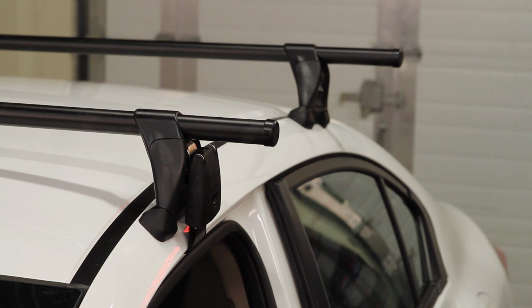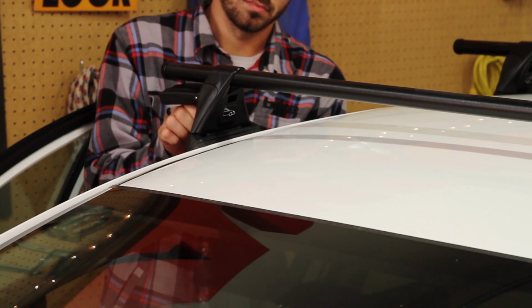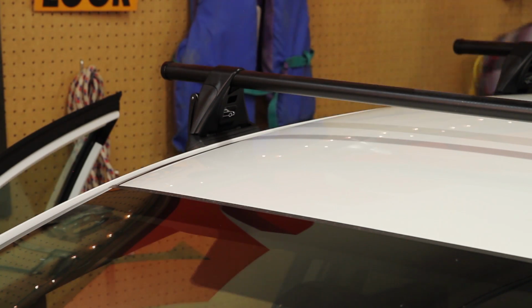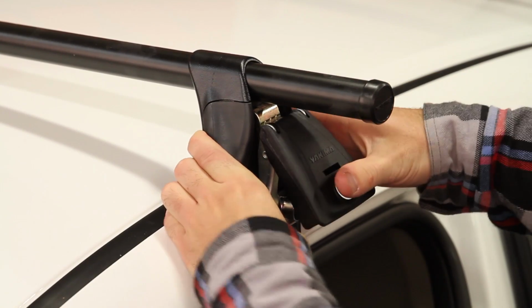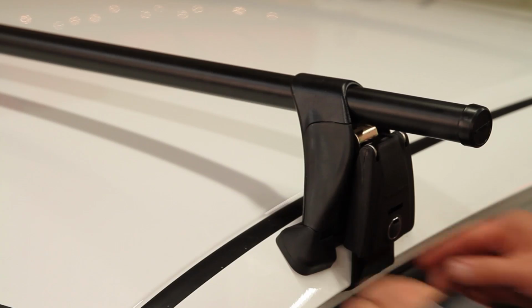Now we're going to alternate towers, gradually tightening the adjustment posts on each side. Holding the Q-clip with your thumb, tighten the adjustment post 1 turn, snap the cam cover shut, and repeat on the other side. After each adjustment, make sure the gold slider is between the hash marks on the tower housing and aligned evenly with the slider on the opposite tower.